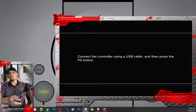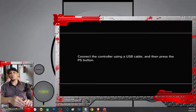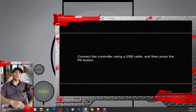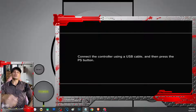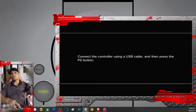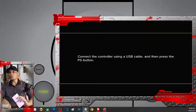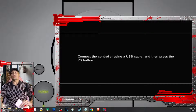Once you have your replacement hard drive, we are going to need the firmware to install on your PS3. For the firmware, we have three options. If you're using your PS3 like usual, you'll definitely need the official firmware. If you're using a PS3 with HAN exploit, then you will need the hybrid firmware. And if you are using a custom firmware, then you'll need CFW. If you're on CFW, you may go ahead and directly install custom firmware right after you replace your hard drive. On this video, I'm going to use a PS3 that previously had custom firmware installed, but if you had installed hybrid firmware first, you will have to go through the process of installing the custom firmware.